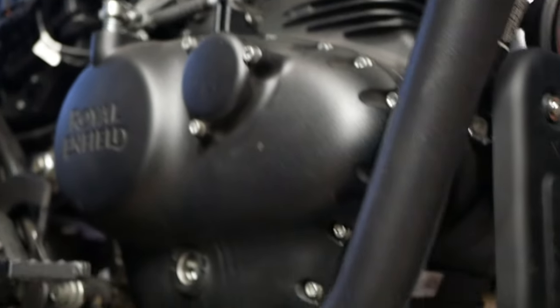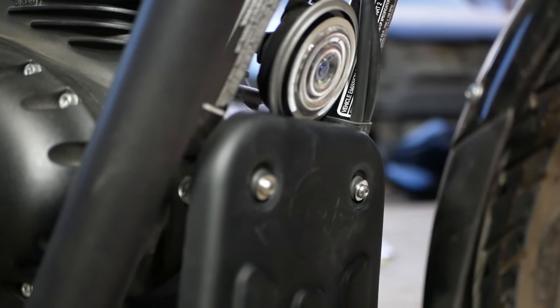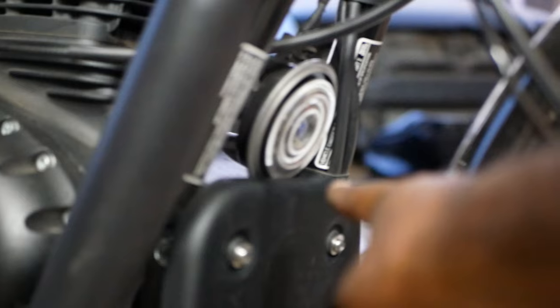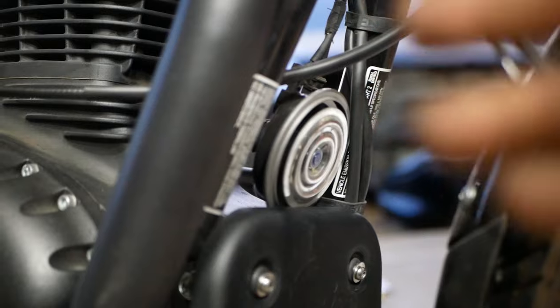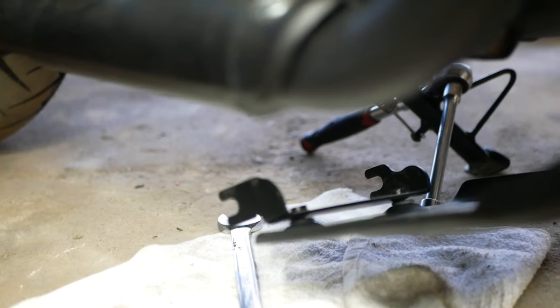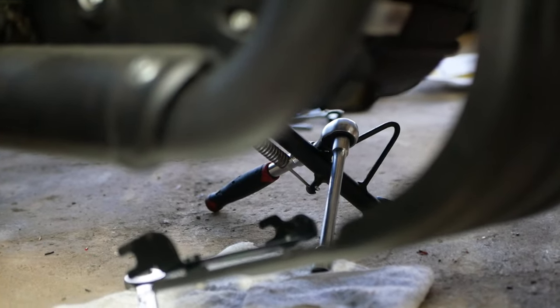It's getting really dark in here — I'm trying to do the best I can with my current lighting. There it is right there — bolt it on. Reverse the bracket so it fits down and you should be about here by your horn, just so you guys know. By the horn — that should be right there. That's the best spot, that's the highest point with that bracket installed. And then down below, with that bracket facing away from the skid plate, you can hook it in, slide it, and then tighten everything down.